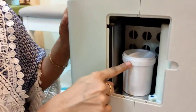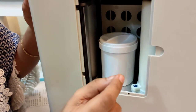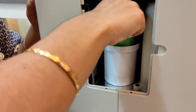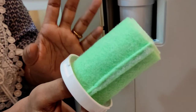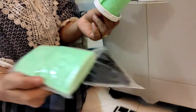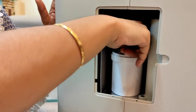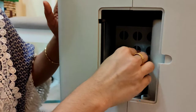You've also got an extra filter here. There is another filter — the secondary filter. For that, there is this small container; you have to move the lid anti-clockwise and it opens. Here is this filter — you take it out, wash it with detergent, dry it, and put it back. After 800 hours of use you have to change this filter. Spare filters have been provided as well. Always dry it before putting it back, then turn it clockwise and check that it is fixed properly.